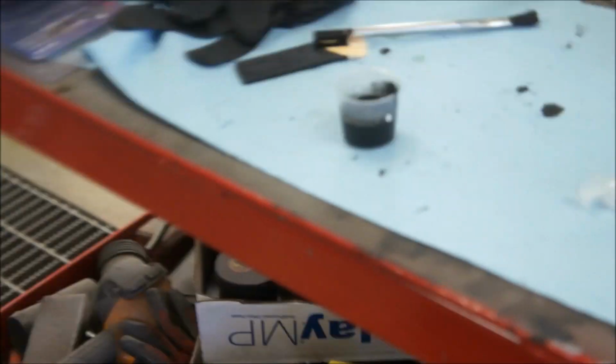I had to mix some more up. I used, I don't know, what is this? So I got 2.5 tablespoons there. I used 2 tablespoons last time, and then once I put a little bit of reducer in there, it'll be about 3 teaspoons. I'm sorry, not tablespoons, teaspoons. So I like to use that because you don't waste much, and if you need to do a little bit more, especially on something like this, because you don't use a whole lot of it, so there's no reason to make up a big cup of it and just waste it, you know.